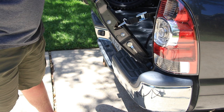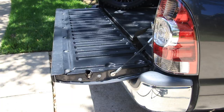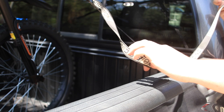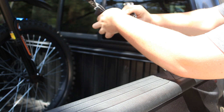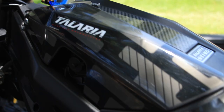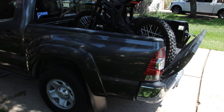When you're ready to go ride, all you have to do is unlatch the tailgate, pull the bike out, and you're set. Make sure to tie up the ends of your straps — the last thing you want is for them to be flapping around, or worse, go off the edge and catch a tire. To do this, take all the length of your strap, double it, double it again, and then tie a knot using the whole length. Make sure it's a snug knot pulled down the full length so it's all nice and tight and not going anywhere. Make sure you don't accidentally leave your keys in the bed either. Now that your bike's all loaded up safely, go out and have some fun. Thanks for watching.